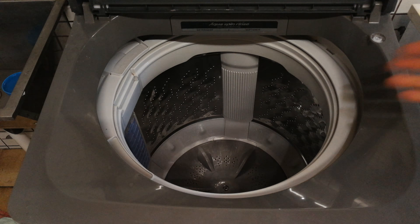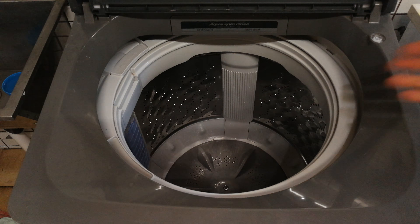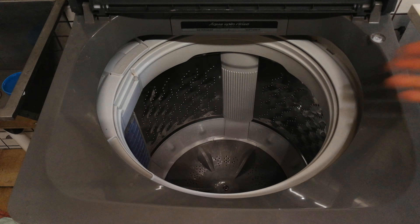So the fault on this washing machine was the little rivet which got caught in the impeller — probably was in the pocket of whoever was using it, and went through these little filters and into the impeller. Bottom line: the impeller was blocked, you unblock it, you're done. Hope this was informative, thanks for watching — cheers!